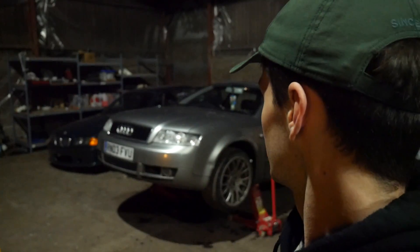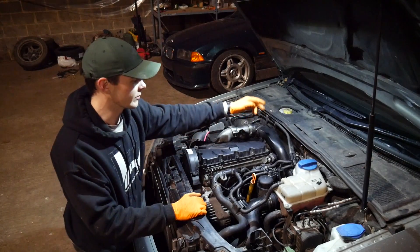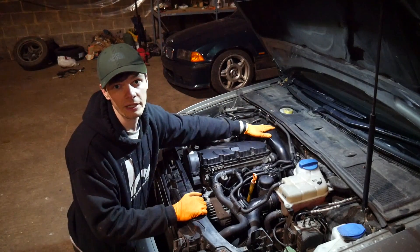There's probably not enough time to do the incline test properly, but if I could leave it jacked up all night I would. Since I can't — I need to drive it home — I'm going to drop it down and have a look at the back of the engine, specifically the tandem pump, to see if there are any physical signs of diesel leaking. If diesel can get out, air can get in. The tandem pump is so called because it does two things: vacuum and fuel.